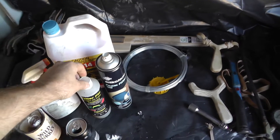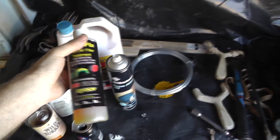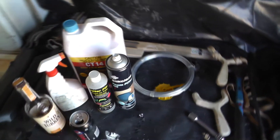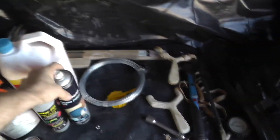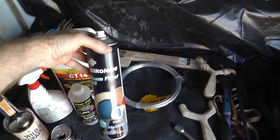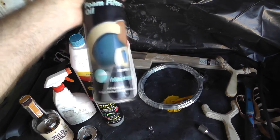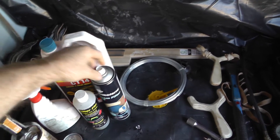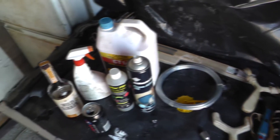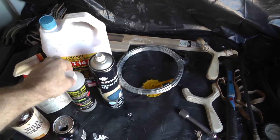Cleaner than you need it to re-oil. Theoretically, if you're going to do a foam filter properly, you should really use an oil bath — just in a plastic bag, drench the crap out of it, squeeze out the excess and bolt it back on. Because it's only a pre-filter, I'm going to use just the spray-on stuff. A bit dangerous for doing the main filter on your KTM dirt bike or something, but the trick with it is just to be really, really generous. Don't use motor oil on your foam filter, mate, but you've got to oil it up before you put it back in.